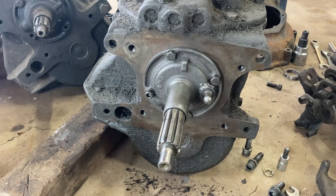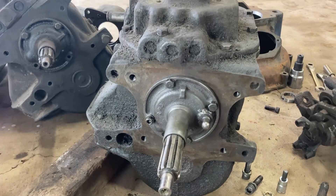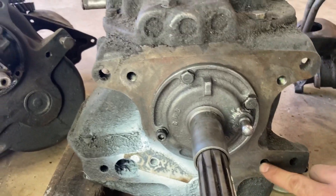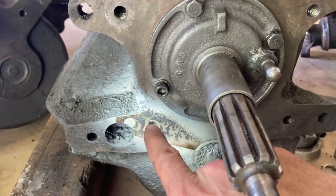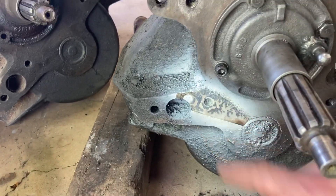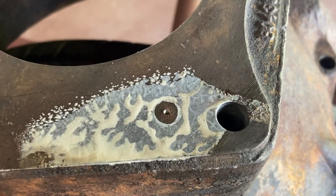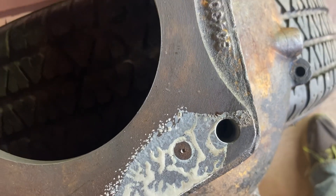This side is done and ready to go right into the L134. This fits a GM nine and a quarter inch clutch disc, and we're using the CJ5 pressure plate, CJ5 flywheel, and starter. Once it's all together I've got to clean this off and we should be good to go. I was able to use three of the transmission mounting holes, but one was off, so they had already drilled and tapped the case. For a situation like that, I take some spray paint, hog it on there, let it dry a little, then press your part against it — it indicates by this hole — then center punch it and drill it out.